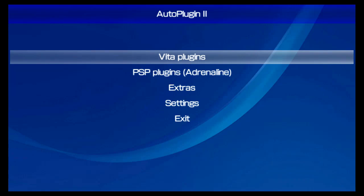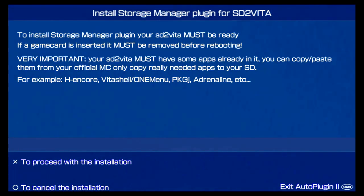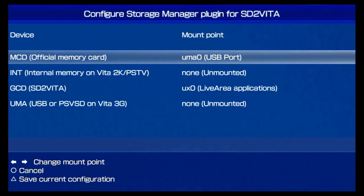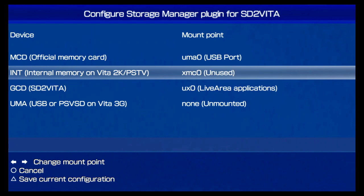What I did is I went ahead and updated and moved the content over. I used a really good guide from Blaine Locklear — I'll share the link down in the description. Basically what he instructed is to use this tool, the storage manager for SD2Vita. The plugin manager lets me set that up very easily and does all the config for me. I just had to specify settings, mostly focusing on how I wanted to access the internal memory. Basically all the content will be running off of my SD2Vita with the micro SD.